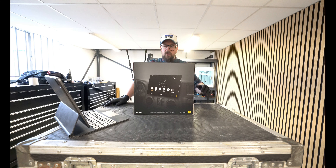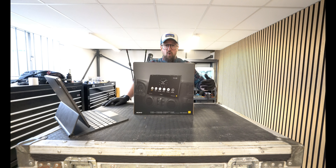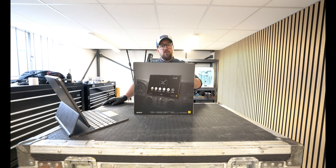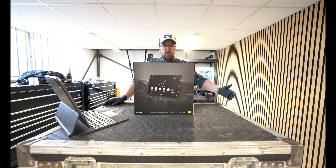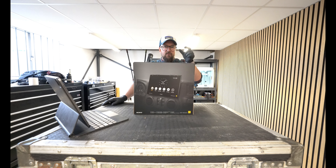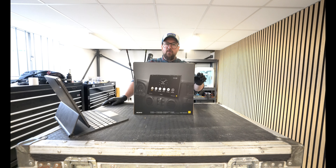That's what the delay was. So Mobile ES — elevated standard from Sony. Everything SQ has been turned up a little bit. It has an ESS DAC onboard, which is a nice high-quality DAC. So everything going in digitally will be converted to the best of its abilities and then out of its RCAs or its own amplifier — 55 watts per channel onboard. You should be able to build a system without amplifiers temporarily. We typically use head units with amplifiers, active speakers, and DSPs. So I'm interested in a relatively narrow bracket with this unit, based purely on SQ and GUI — the speed of how it works.